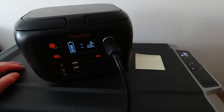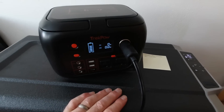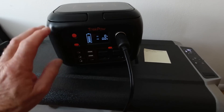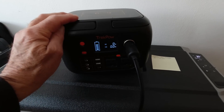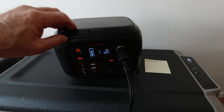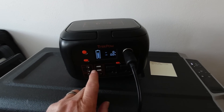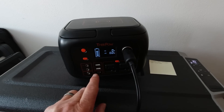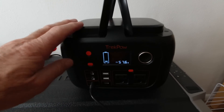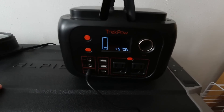At this point, it's been 25 and a half hours — maintaining about 30 degrees right now. The Alpicool just shut off. You've got to remember though, the ambient temperature is just 66 to 68 degrees here where this is sitting. Although I'm totally impressed with this, if it was 80 or 90 degrees in the room, you'd probably only get about half this time. The impressive thing is that it's running the refrigerator. I'm going to let it go all the way dead for testing purposes, and then see how long it takes to charge back up. I took it all the way down to nothing — basically it had one bar left. Evidently it's got circuitry that protects it from going too low. It ran this refrigerator for 32 and a half hours. I was pretty impressed with that, even at this temperature.